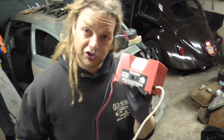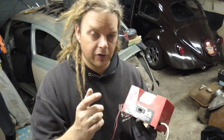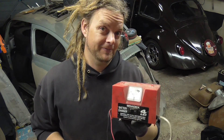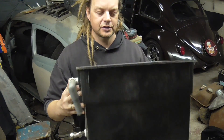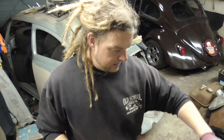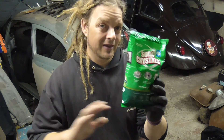Today we're going to go again. Craig assures me it'll be okay because I don't want to damage my little heirloom charger, but we're going to use a 12V car battery charger on the trickle charge setting — the low setting. He says it'll be fine. So we're going to use this as our power source. You need a big old tub — an old water tank, bucket, anything will do — and we're going to fill it with water. We're in a soft water area here, and we're using soda crystals as the electrolyte. Simple as that.